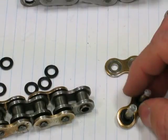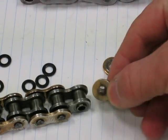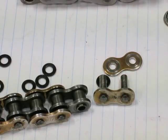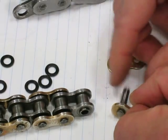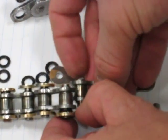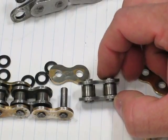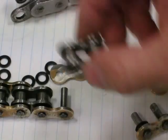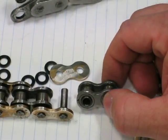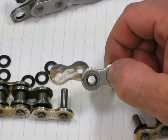These pins are just circular rod stock cut to size, and the ends of the pins are worked off like that on a rivet to make a permanent connection with the plates. These are the outer plates and the pins. You also have part of a link — this little piece on a roller chain which has the rollers, which should move freely. It's got inside plates, and the pins on the inside are hollow — you can see through them.